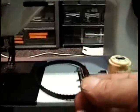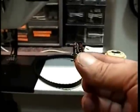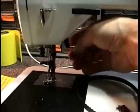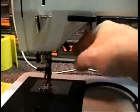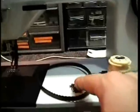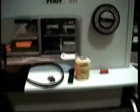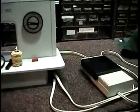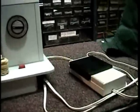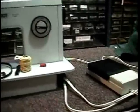This little guy here is the synchromatic stop switch. When you push it down on the lever in the back, the machine should do a revolution once and stop. If it doesn't, then there's something wrong with this switch or with the settings on the circuit board. I'm using Dave's original foot pedal because I haven't gotten the parts for the other foot pedal yet that he wants to have and use.